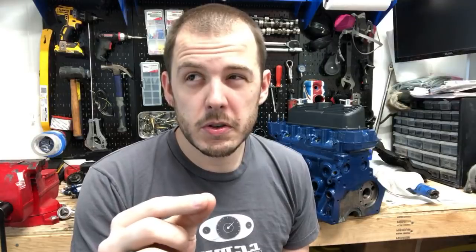So if you have a single carburetor on your car right now, and I bet you do, and I would go out on a limb and say it's probably an HS4, you've already got a pretty big carburetor. It's already got a pretty high flow rate. So really, if you were going to upgrade from that, you can move to like an HIF44 or HIF6. I always get these numbers mixed up. There's HIF carburetors, which is kind of a modernized version. Yeah, HIF44. They're great. Single carb as well, but it's a lot of flow.